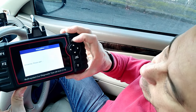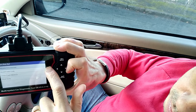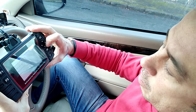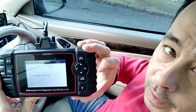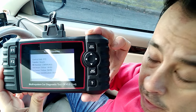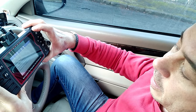You just navigate through the little thumb arrows here and press enter. So it comes up with the first page. Have a look at this number in the corner - it says one of four. So that tells you there are four things going on there, but each of those could have more menus further into it. So module information - if I hit that, it will talk to the car and tell me what device it is. So this is supplier Bosch. It's got the Mercedes-Benz part number on it, hardware status - that's probably when the device was manufactured - and software status and diagnosis identification.